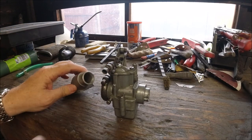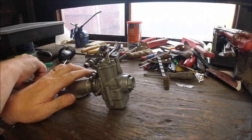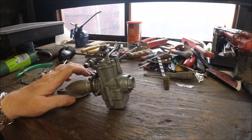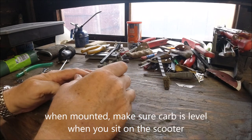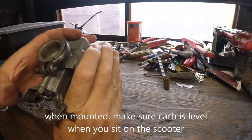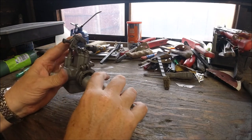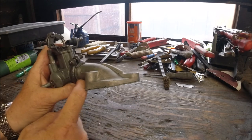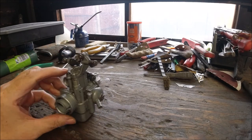It's clamped onto the cylinder and pushed on, then you've got this screw — I always use an 8mm socket to tighten it. Do it tight then a little eighth of a turn more so it doesn't break — what it will do is break through the casing or the thread will go. Also, these inlet liners wear out and you end up sucking air — it should be dead tight but be able to turn. When it's sealed you won't get any air sucking in, because that will mess up your mixture and cause seizures and running problems when hot and cold.